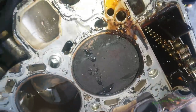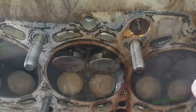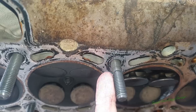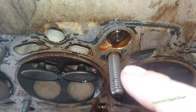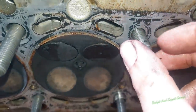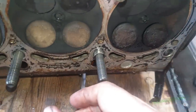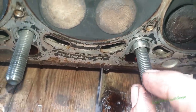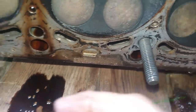And yeah, let's see this head gasket now where it was actually gone. What I've actually done is I've left the bolts in there, but you can just see a bit of the metal there. Look, that's one thread. You can see metal now, there's oil and water and everything on it, but you can see bits of metal there, bits of one there. The ends are absolutely perfectly fine, just like we knew they were. If I get close, you can see a little bit of metal there. It's not good when you look closely at this.